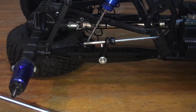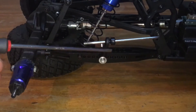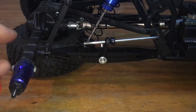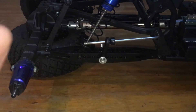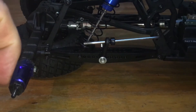From testing with the sway bar parallel to the trailing arm, it resulted in a massive improvement over stock, but it still very slightly began to lift that front right wheel. So all I did was move the ball joints slightly further forward, using the holes as a reference point - originally above the sixth hole, now above the fifth hole. Moving the ball joint back increases flexibility but reduces rigidity. Move it further forward and flexibility reduces, rigidity goes up, and therefore control goes up. So the torque twist now has to fight even harder against the bar. At this point the bar had overcome the force of torque twist and now keeps all four wheels on the ground. Hey presto - success.